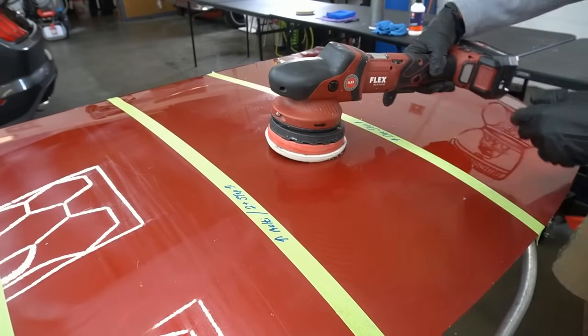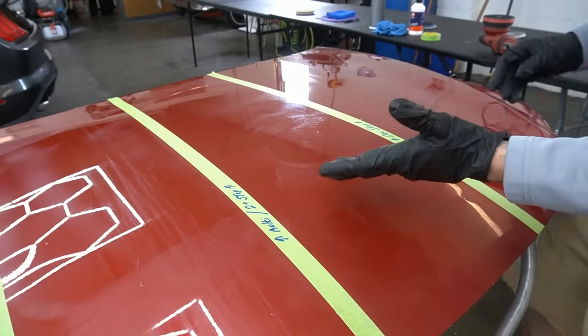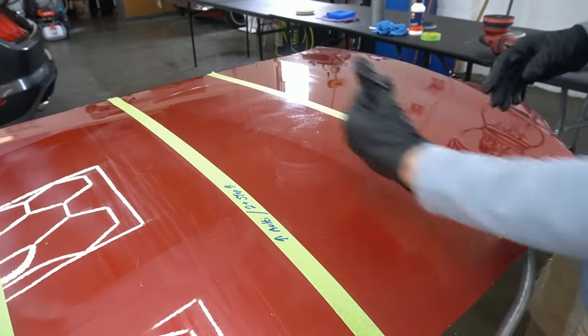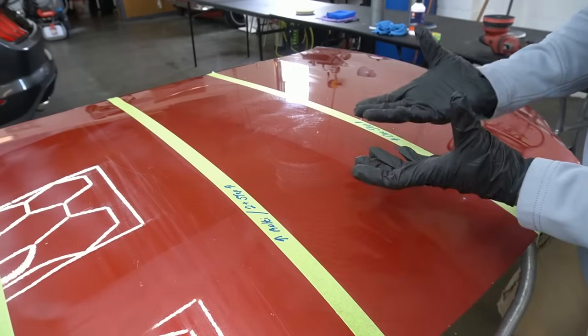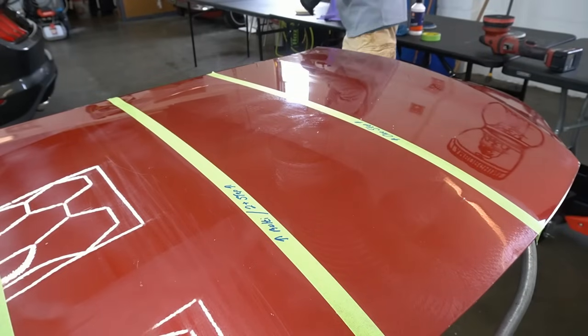All right, that pad's getting worn out. It's getting a bit wobbly. So the difference between, well, obviously the pad's more aggressive. The correction fluids for the one-steps are going to give you a pretty good cut within the first step or two, and then the abrasives will break down or round off, and that allows you to give it a good finish. So let's wipe off the residue.